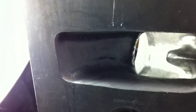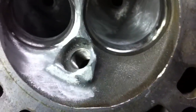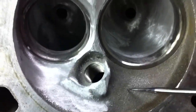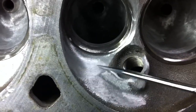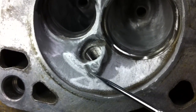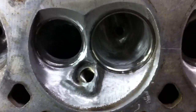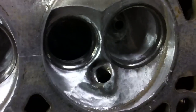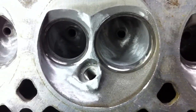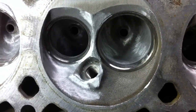Since I can't move anymore on the ports, I've moved to the combustion chamber. I almost forgot to shoot a video of the before and I caught this last piece — you can see the factory casting there. The other side I have started on already. Right now I'm just doing the first cut, knocking off the majority of it. I want to go back and get inside the small grooves with a tapered or smaller diameter tootsie roll later. This is just the first cut so they look rough, but the majority of the casting is removed. Hopefully I'll get this done tonight and touch up anything else while we're waiting for the mandrel to come in.